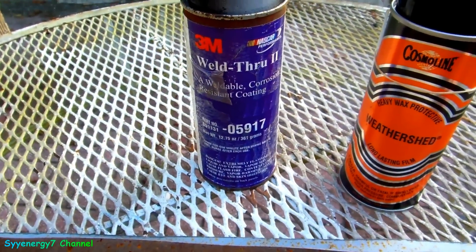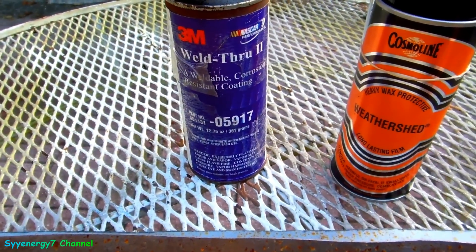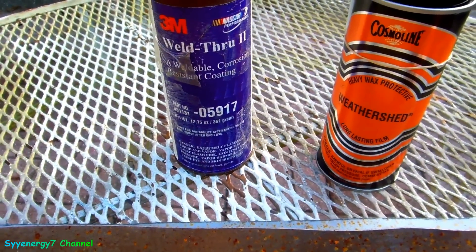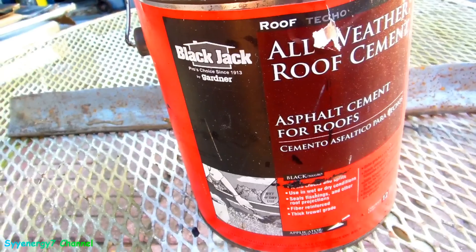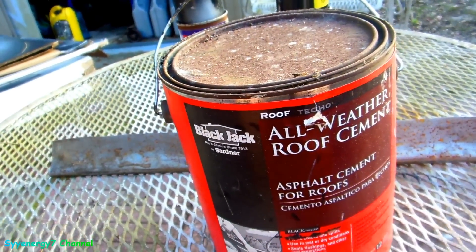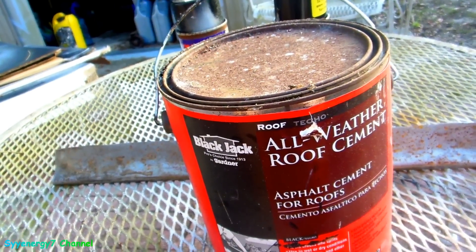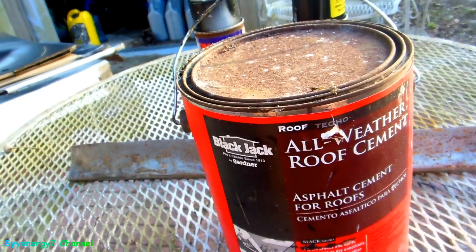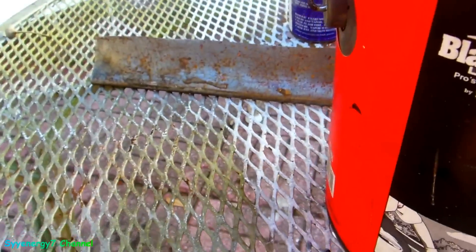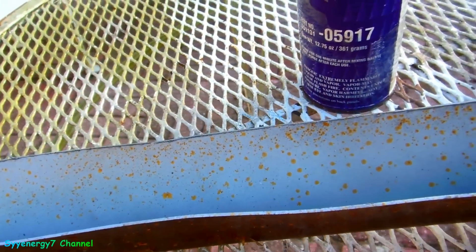To tell you exactly where to spend your money on rust-proofing: roofing tar is not a bad deal to put on the inside of panels — it's cheap. You can get a gallon really cheap, especially the high-quality stuff. They also make spray roofing cement which is even higher performance. Coating the inside of your car panels with this kind of stuff stops moisture. For the price, it does work — it's not designed for cars, but it's cheap and effective.